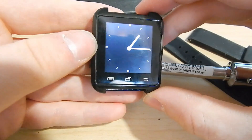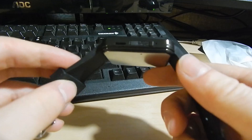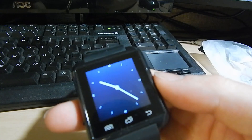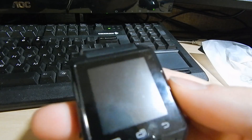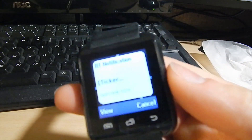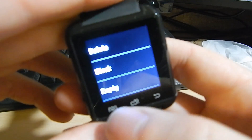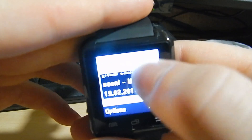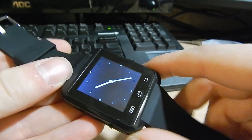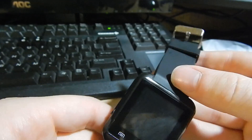Alright, let's go ahead and test this and give you guys the verdict. You'll be undoubtedly glad to hear that the modification actually worked and the watch now behaves much nicer. I'll go ahead and send it an alert — it's much much quieter than it was before. Now it just sounds kind of like my phone when it goes off. It's still quite a violent vibration, but it's working a lot better now. So if you do get one of these and it's really loud, that's something you can do — just open it up and jam a bit of foam in there to keep it from vibrating.